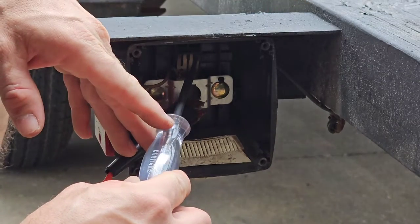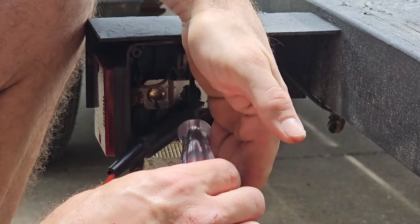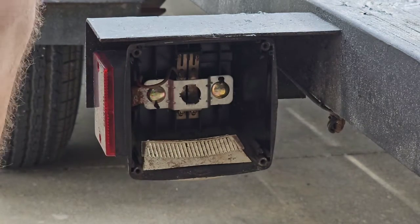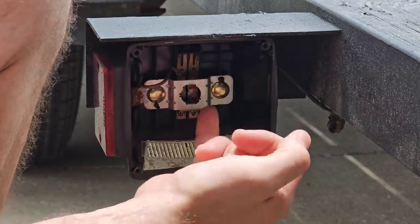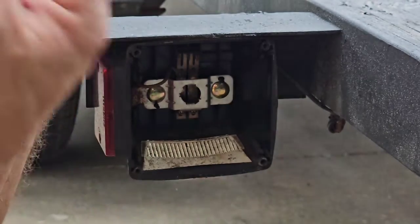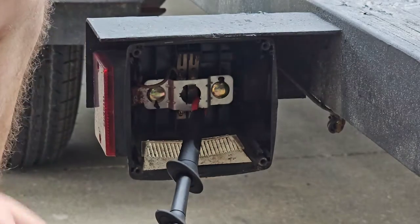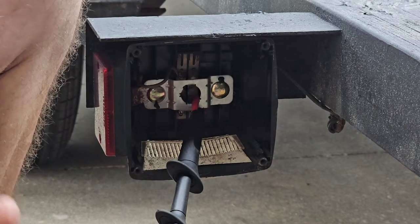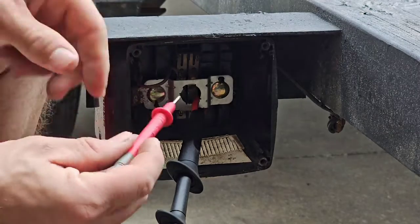So I'm going to touch the wire — and it's actually working. The brake light is actually on; I've got the brake lights on the vehicle right now and I'm going to touch this plate. The light is working. Let me show you on the multimeter. There must be a connection issue inside the light housing right here. What I could do to fix this is pull out that little band so it's making better contact with the bulb, since we know the bulb is good already. You've got to be patient and eliminate the issue. If it wasn't working here, I would go up and test the vehicle, confirm it's good from the vehicle, and then I know it's somewhere between the trailer plug and here.